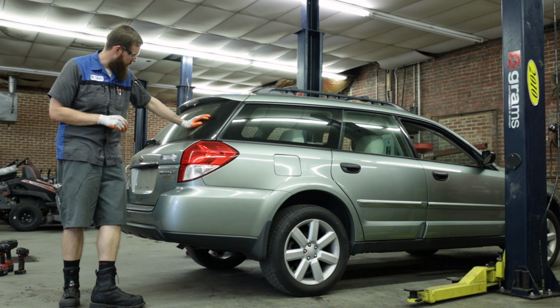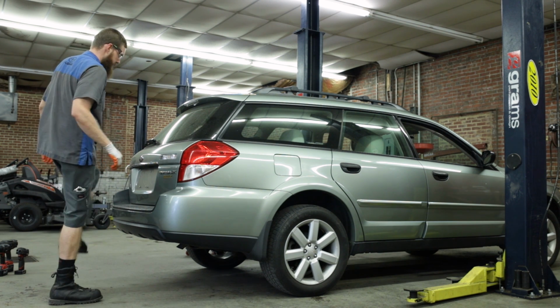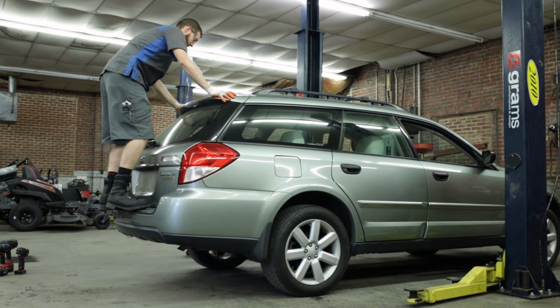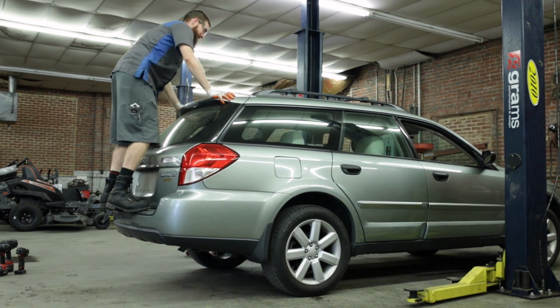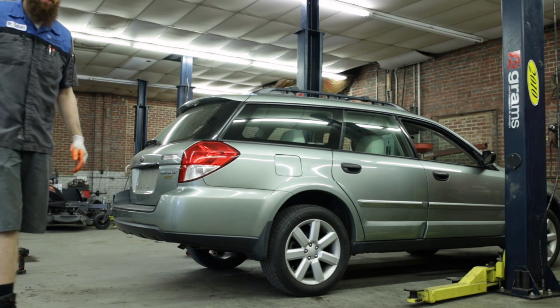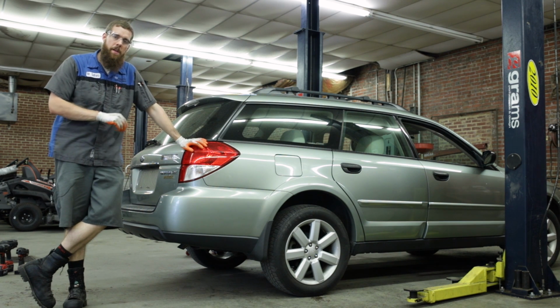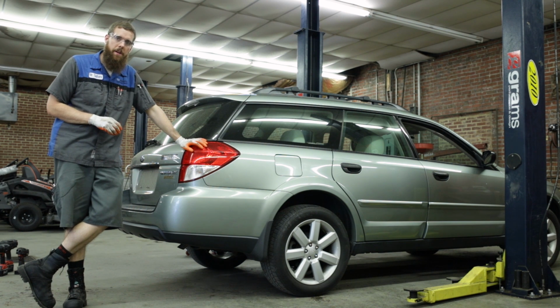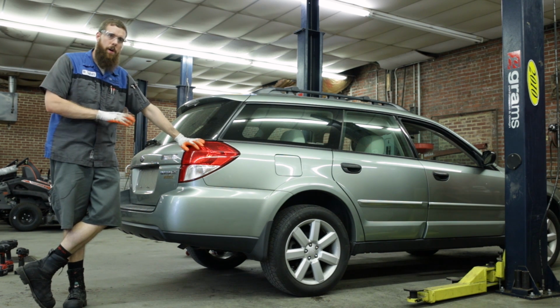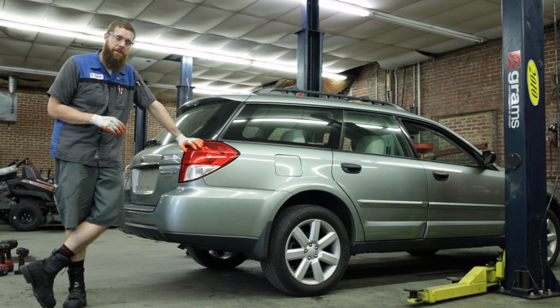One more check real quick before we finish out the video. Let's do another rear suspension shake test. Got a little bit of squeaking going on, probably some suspension bushings, maybe sway bar end link, something like that, squeaking under there. It will take a little while driving for the new struts to settle, but other than that, huge improvement over those old busted struts that were on here.